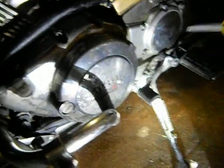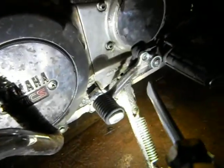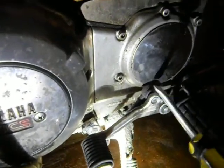Mike, do you see these screws in that cover? I'm getting the garage a little cramped up this morning, but I'm doing the best I can. These screws right here — one, two, three, four, five, six screws — hold that cover in place. The bottom screw on this cover, right down in here that I'm pointing to, is also a drain screw for draining that forward bevel gear housing of the small amount of oil that it holds.